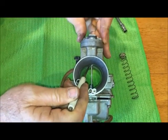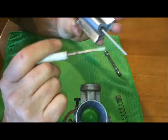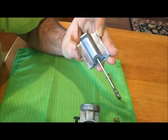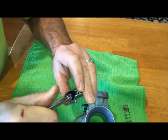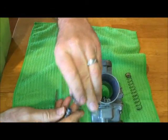I'm going to take the slide out of here. What makes the needles on the carburetors different is really just this taper at the end. This is actually a Honda needle — it is an N82M — and it has a more aggressive taper. This is a six-millimeter nut in here.